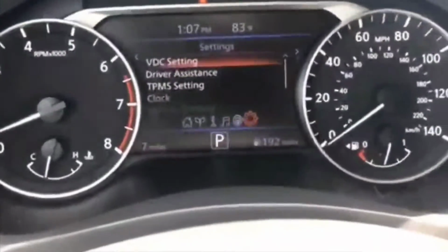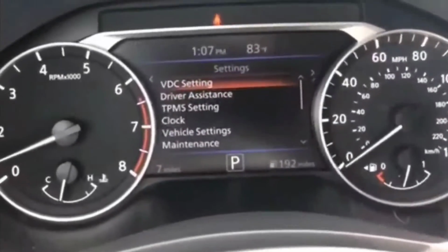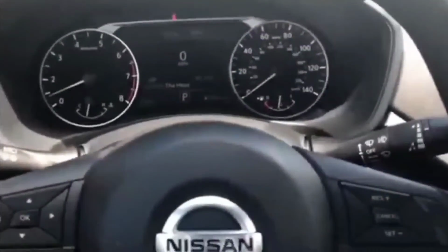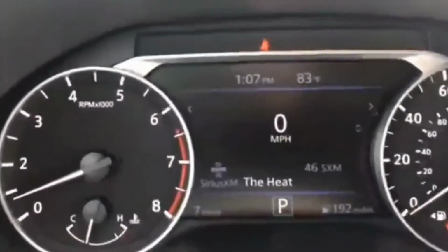So I was looking at the relays, particularly the starter relay. I was like, okay, maybe it's the starter. Maybe it's the starter relay that's the problem. So I swapped out the starter relay with another relay that was similar.